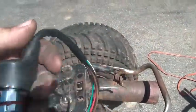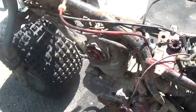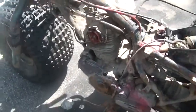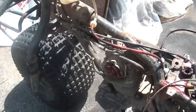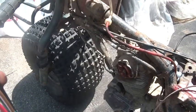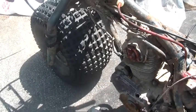Now let's say I want to put this key switch on this bike. I'll hook it up exactly as described: green to ground, black and white to the CDI - it has to get to the black and white wire on the CDI that turns the bike off. This switch has an extra position involving the brown and white wires and the brown wire, so ignore those two. That only leaves me two wires.